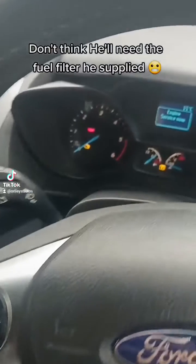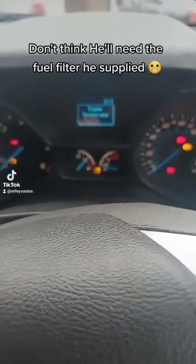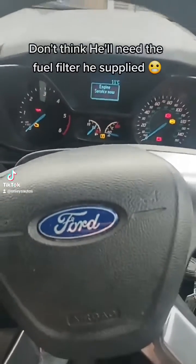So let's get this fired up and I'll click on a health report. Now while it's loading — I don't know if you've got any idea what's going on here, but I think I'm very suspicious of something. It's got 140,000 miles on it and I'm suspecting it hasn't had the cam belt done.